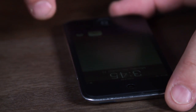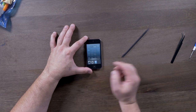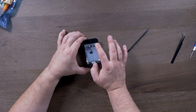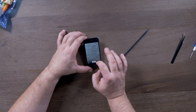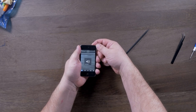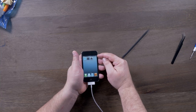Now that it's booted back up, I'm going to retest: test my digitizer, slide to unlock, grab an icon and move it all over — make sure the icon doesn't drop. Test the home button with a double click — the screen should pop up. Open the cameras to make sure both the front and the rear camera work. Record another video to test the microphone — test one, two, three. Play that video back. Make sure volume up and volume down both work. Press the power button to make sure it sleeps. And lastly, reconnect it to the charger and make sure we get the battery charging indicator.